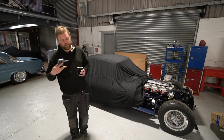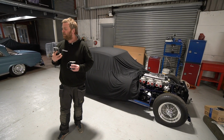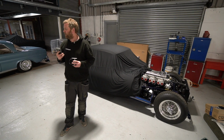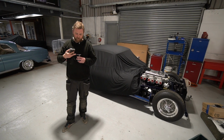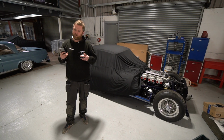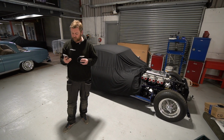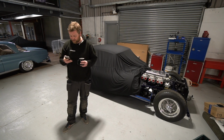They do on-wiper-arm jets, which is also a very interesting thing, which we're employing on a few cars coming up. So they fit onto your standard rectangular profile classic wiper arm and mount the jet on the arm. Now we've done quite a few before that have a long spray bar on the arm, but it was an interesting discovery. So yes, good question, and there's your answer.